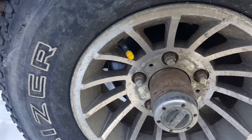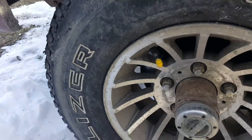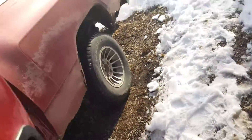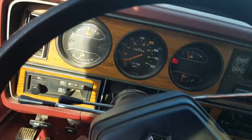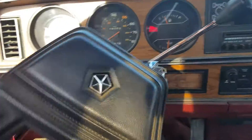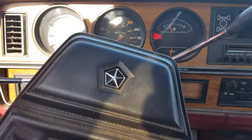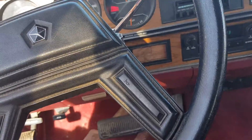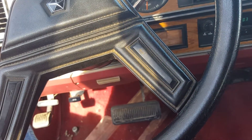Four wheel drive worked — I had to use it to actually get it out and take it for a quick test drive. It drove actually quite nicely, surprisingly. It's just a three-speed transmission, but overall it drove nicely. Needs the alignment bad and the steering tightened up bad — that's about how much play I've got in it as it sits right now. So I've got to tighten up that steering box.